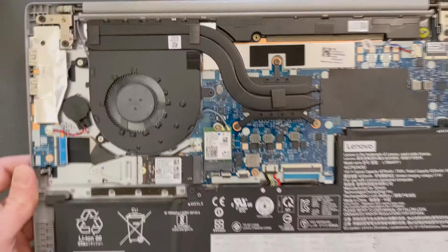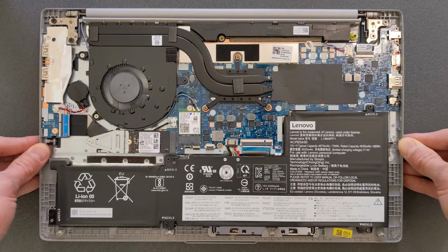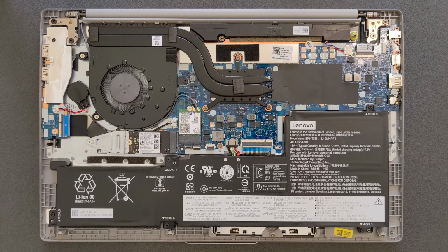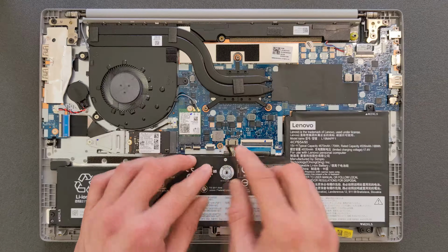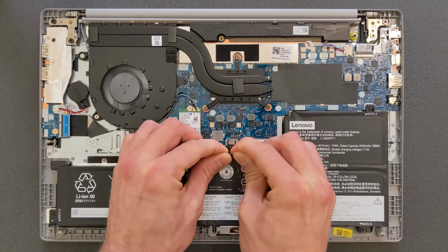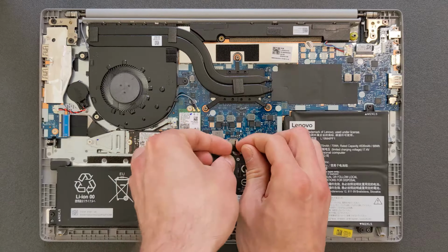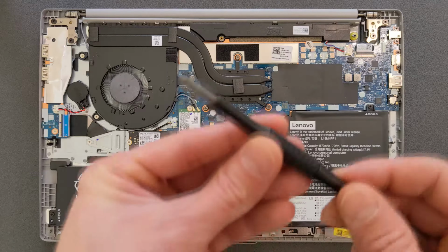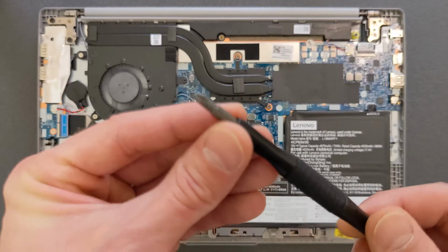And to upgrade your M.2 solid state drive, you need normal Phillips screwdriver. And before you do that, disconnect battery, of course. You can do without it, you can leave the battery connected. It worked for me several times, but I do recommend disconnecting it. It's only a second or two. And that's your normal Phillips screwdriver.